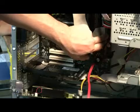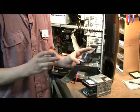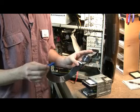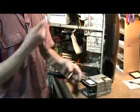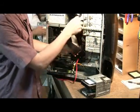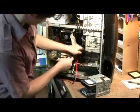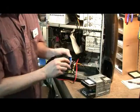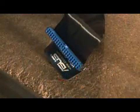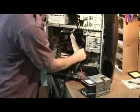I notice my IDE cable is going to go right here. Now if I install this hard drive it might be hard to get to. This end here typically goes to the motherboard — so this plugs into the motherboard right here. And these two connectors are going to go to one drive and two drives. I'm going to plug this right in. Keep in mind these all pretty much have an index on them to help insert it so it's not upside down. We have that installed.